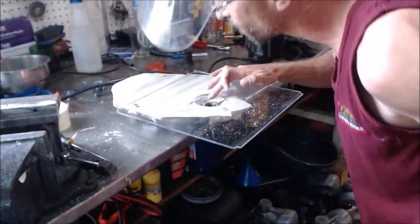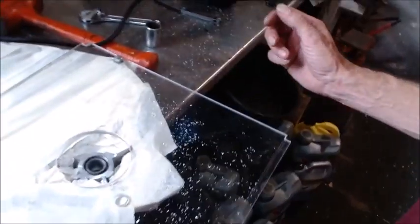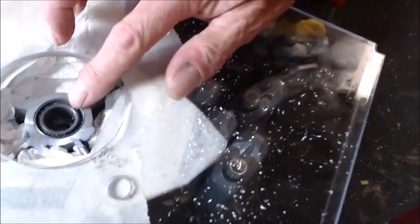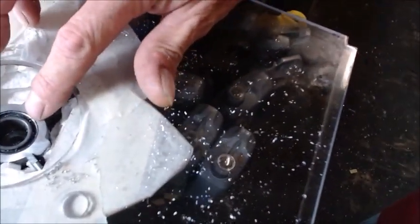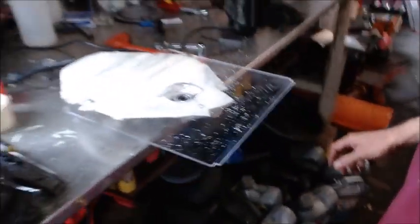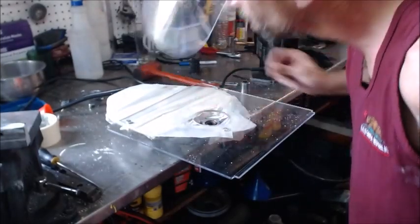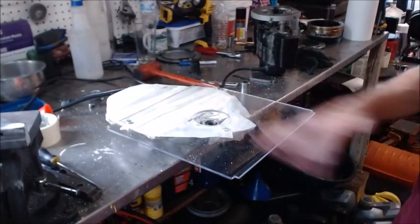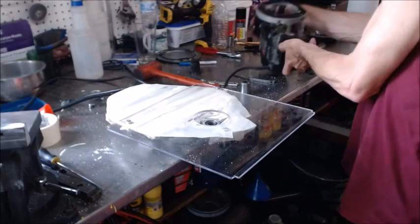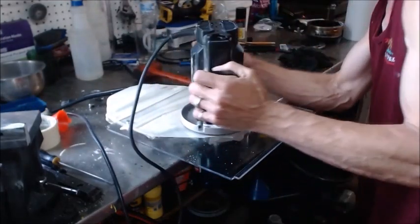After a few passes, you can see we are getting real close to the surface of that bearing, so we're leveling her out. Everything looks still good — nice and smooth — taking short passes. One more cut I believe, so we'll set up and do a real shallow cut. We'll be tight — 10,000 should be all we need.